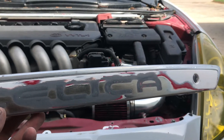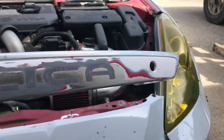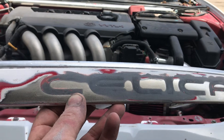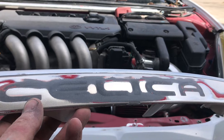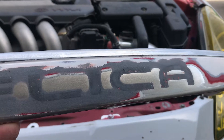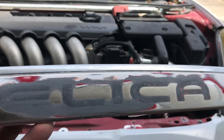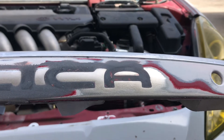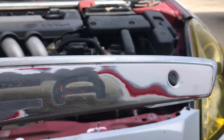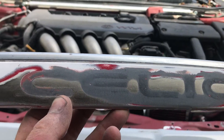This is the piece above the rear trunk latch. What I did is I filled it all in with JB Weld again. I'm not a body guy, but I've dabbled and experimented and researched enough to know what works. JB Weld is actually super strong and it's a lot easier to deal with than fiberglass Bondo resin. I went ahead and filled it in and I've sanded for about 45 minutes now — you can see where the letters are in there. You do have to sand up this fake chrome plastic quite a bit to get anything to stick. I can see the original red paint behind there as well as the white on top, and now I've got to go over this with a little bit of glazing putty.